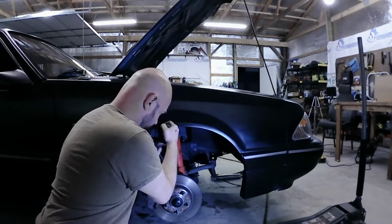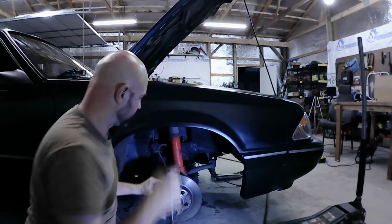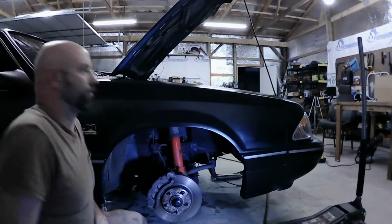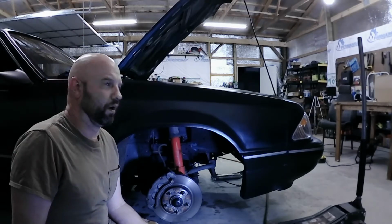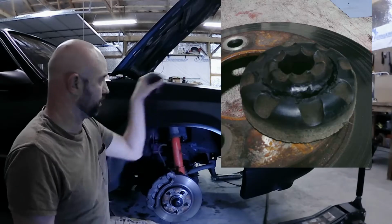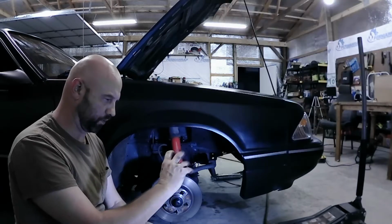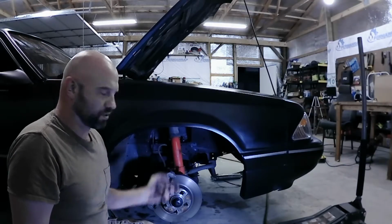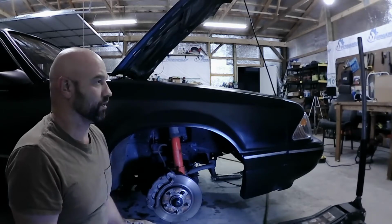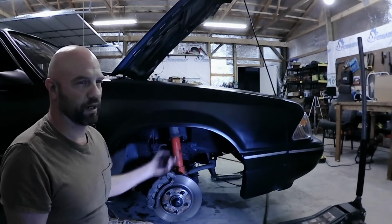So I put my hand dangerously in the way. And I can feel it, the strut is actually coming down, which, if you remember when I installed these struts, the KYB AGXs do not come with the strut hardware up top, the little bushings. I knew I was going to have to replace those eventually, and it looks like eventually has come around. So that'll be one of my projects before I go out and race this again, is go ahead and get those replaced.